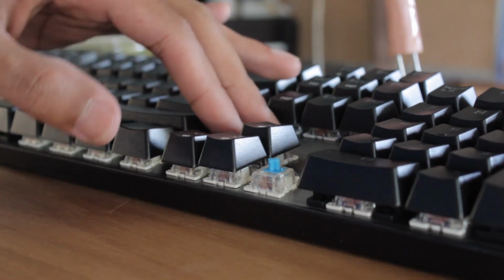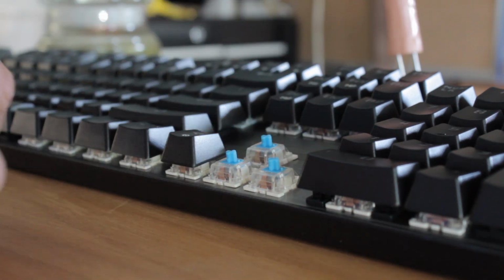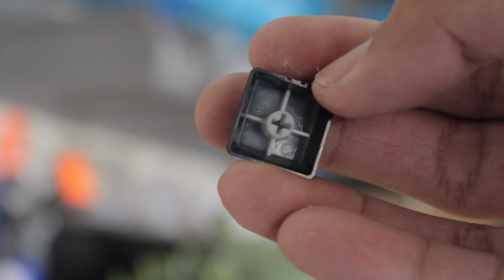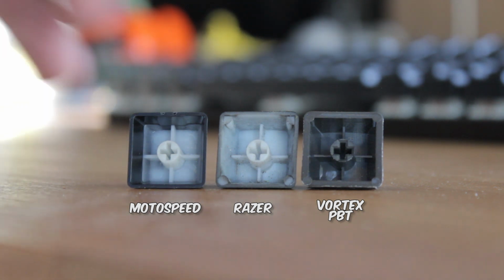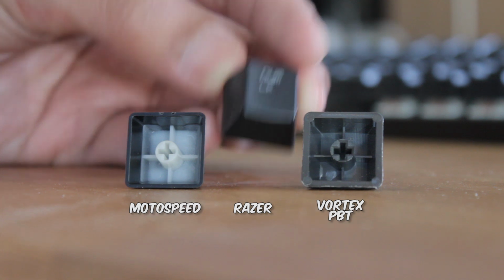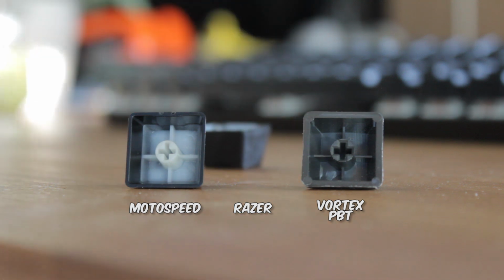So if you want to check out the mechanical key switches below, then buy a keycap puller, which will cost you hardly anything. And taking up the keycaps, these are double shot ABS keycaps. So double shot just means that the character is another piece of plastic, being that clear plastic, which is the legend. This means it's more durable and the character will never fade away. So it's better than like Corsair or Razer type of keycaps, which are coated in black and then laser etched. However, these are very thin like many stock keycaps, which does detract from the typing experience just a bit.